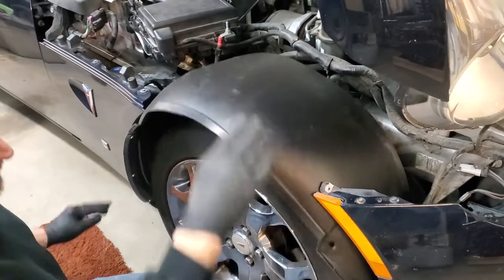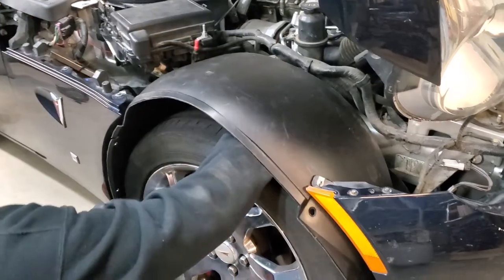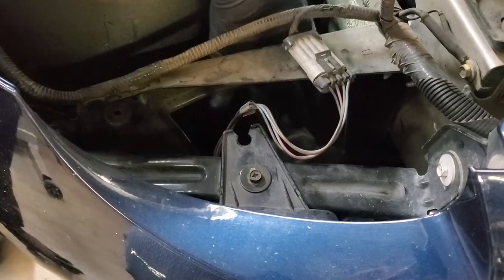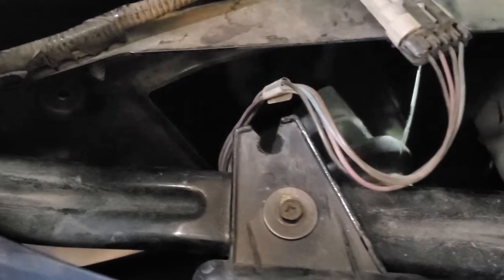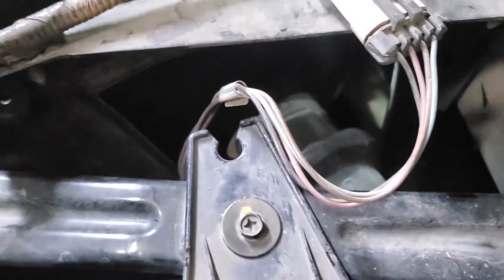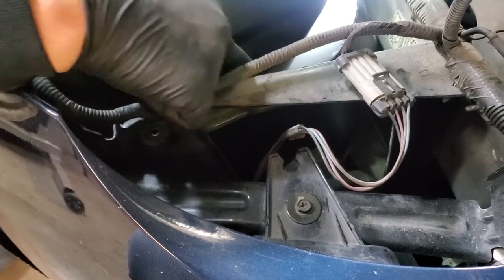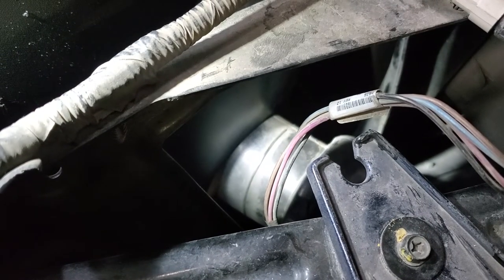You will have to move it around a bunch to get everything into place, so don't be surprised — it's going to do the same thing to you. At first it's going to look like this is never going to fit, but it will. Down in here is your brake ventilation tube. You also have a hole in your new fender liner and you've got to get that hole onto your brake ventilation tube. After a bit, we're going to put a piece of foam in there that we had before, but you've got to get that tube fitted before you start fastening any fasteners back in place.